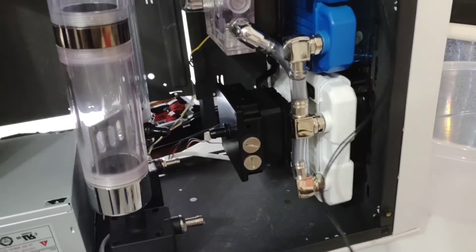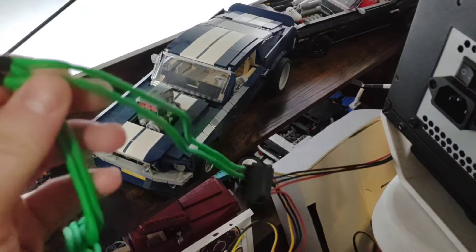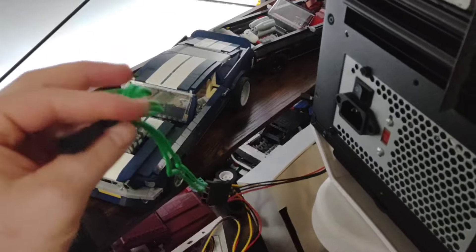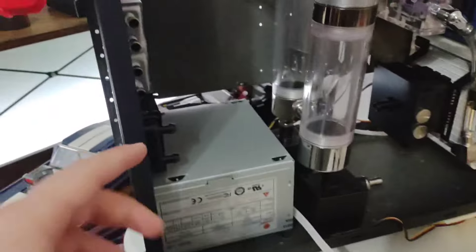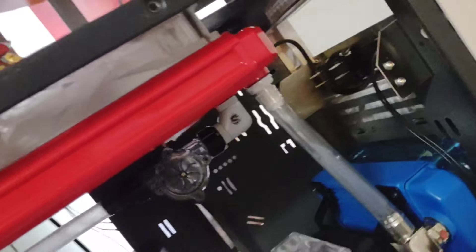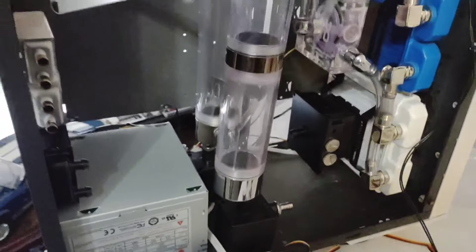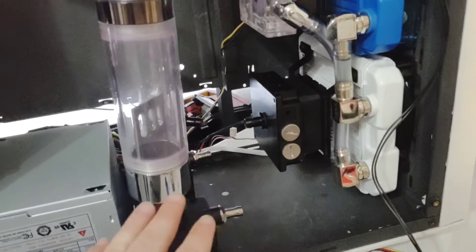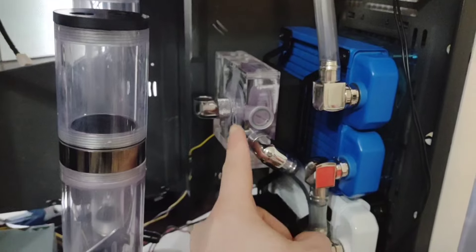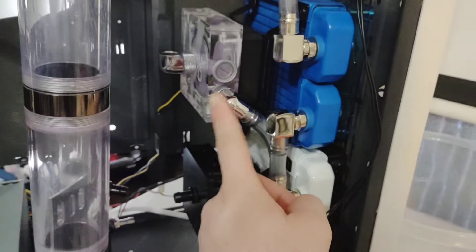It's about time to do a whole bunch of wiring — basically cutting connectors and turning them into three-pin to make things a lot easier. On the back I've got a green-sleeved four-pin to two three-pins, so we can plug two of the pumps in there to power the LEDs and other components. The other four-pin connector will have an extension going into our fan controller. Unfortunately several packages got delayed this weekend, so we probably won't go much further, but we can at least show our pumps mounted to the radiators — it really cleans everything up over here.